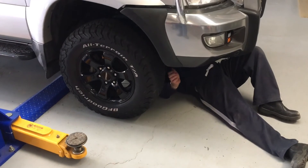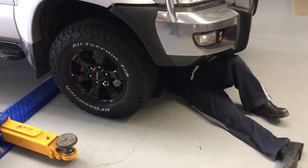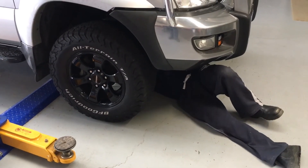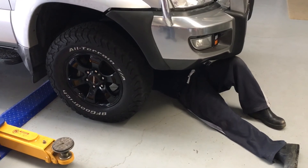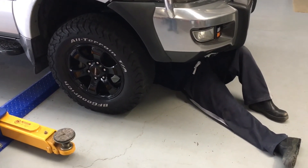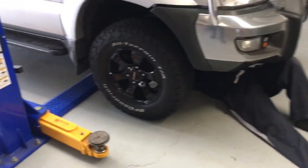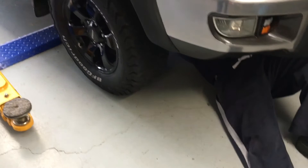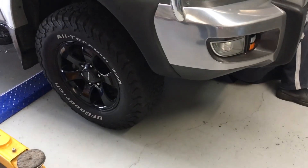Hey guys, Anthony, 4x4 Diesel. Once you fit your new front suspension — the struts, control arms, bushes, whatever the case may be — you do need to finally tighten them on the ground so all the bushes are in a neutral position, which allows for twist and flex either upward or downward. You've got to get your mate down on the floor like this to tighten up those bolts. On the ground so that everything's in a neutral position. Thanks for watching.